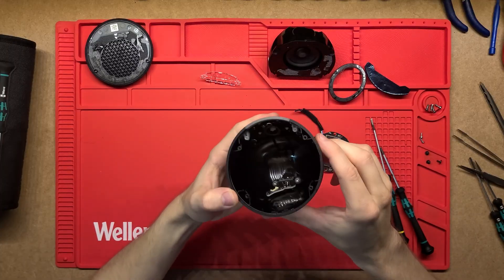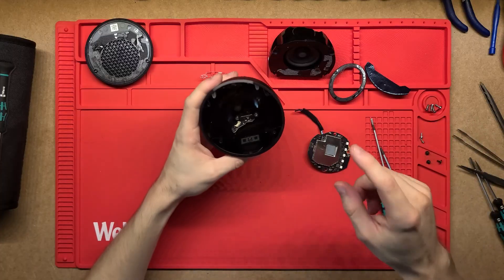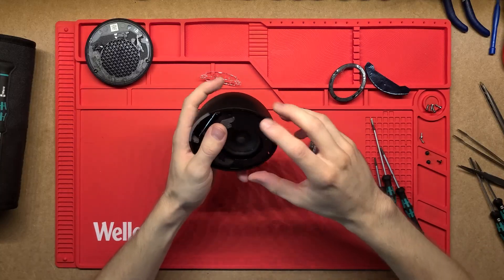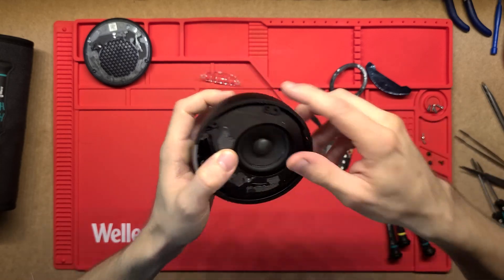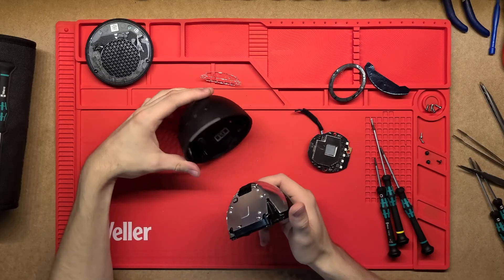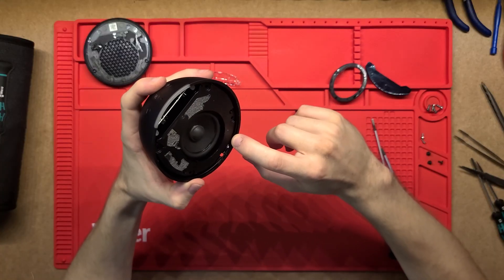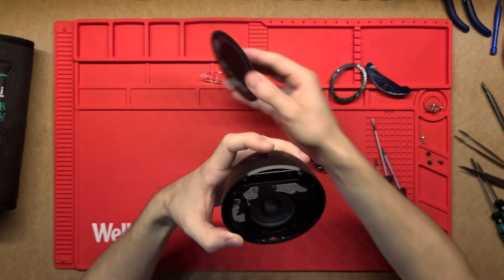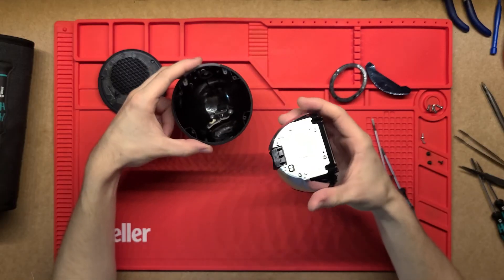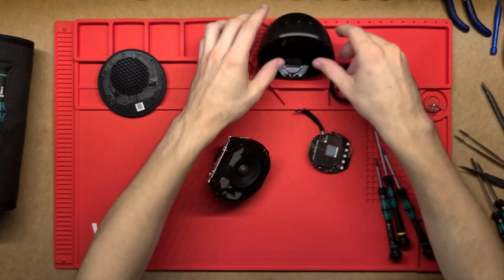The case doesn't really have all that much to it — just standoffs to mount the different bits and pieces. The reason it sounded hollow is that when the speaker sits inside, there's a little air gap between the speaker and the case all the way around. That's why tapping it sounds hollow. It might be for thermal management — fresh air could come in from the bottom with hot air flowing up and out, or the heat sink might contact the case directly to transfer heat. They would have obviously thought about it and made it work well.